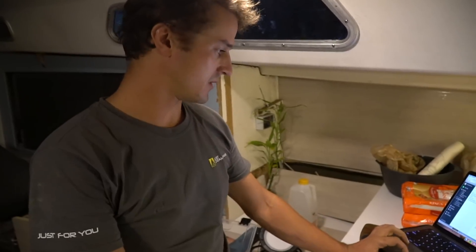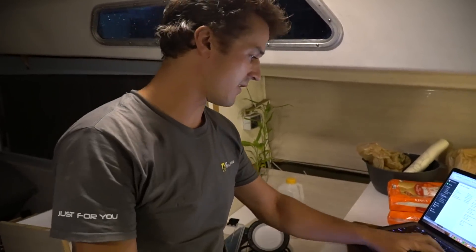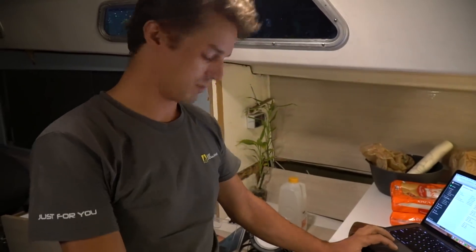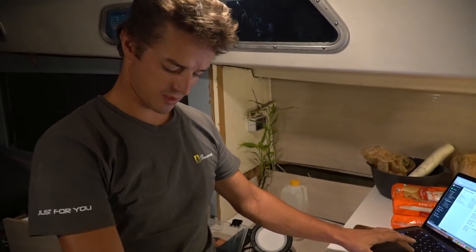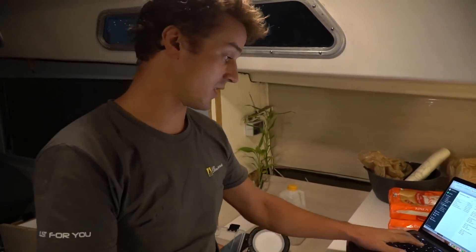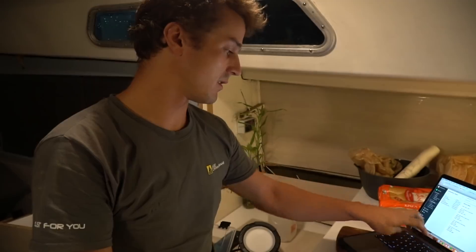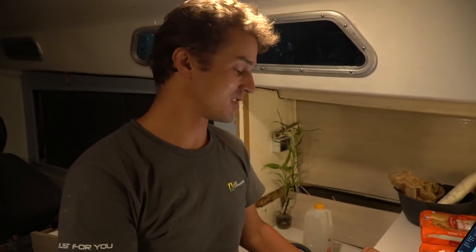We have 75% remaining, we used 55 amps, and the motor temperature is 268°F. That sounds hot, but it's rated for 356°F, so it's still well within its operating range. It's way too hot to touch, but it's supposed to be — so that's actually interesting.